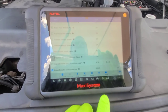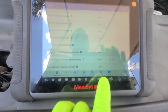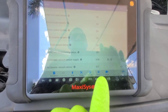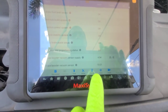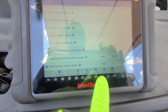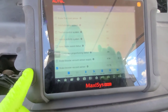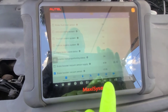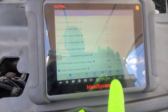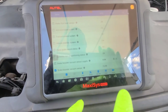Press it a couple of times. When you let go, it's supposed to start climbing back up to keep pressure. When you press it a few times it's going to drop down to around four — anything lower than four is a bad pump. Now we have a good pump and the pressures go back up and the pressures are holding, so the brake booster does not need to be replaced. There's no leak on the system — that's what that means.